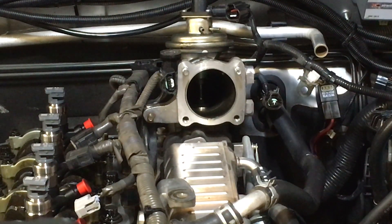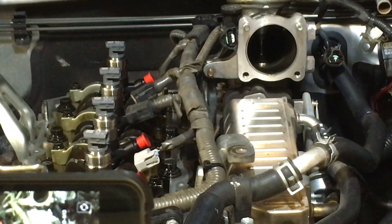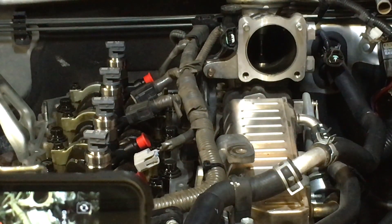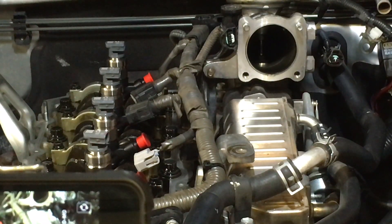Which vehicles need a Pilot Learn? When you replace your injectors, one of the things you need to do on some vehicles is a Pilot Learn. Let's be really clear here. First thing is the compensation codes — the codes on top of the injector. Before you install those, we do it when they're on the bench in order. You can do it at this point, then you know where they are. Take a photo — one, two, three, four — and record that compensation code. Check your photos, make sure you can read it clearly. Otherwise you might be taking your intercooler off or climbing in the engine bay to check those numbers. Every vehicle needs the compensation codes inputted to the ECU.